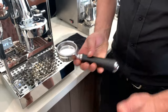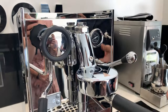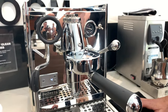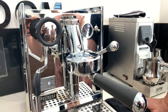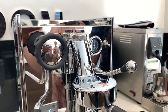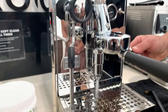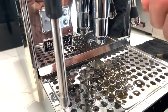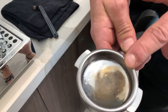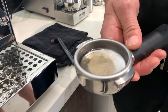That just goes on and locks into place. What I do is engage that, and what it's doing is pushing pressure and water back up into the group head to give it a clean. I usually wait till it gets up to about 9-10 bars, leave it on for about 10 seconds, and disengage. You can see we have some coffee granules in here — that's pretty basic looking. This machine is just for demonstration, so it depends on coffee use.